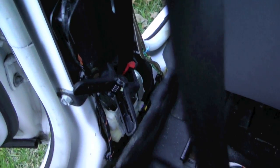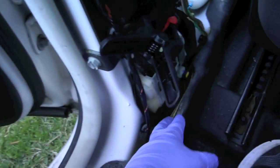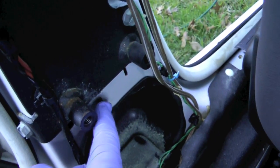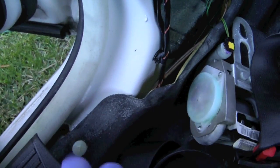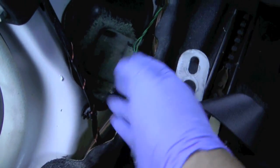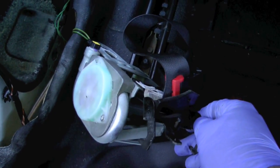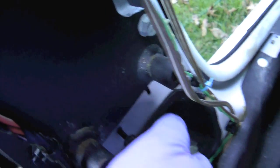The belt is now fully extended and clipped off. I'll unbolt the Torx bolt at the top, the bolt at the bottom, and once those are out I think this whole piece will come out. It's out — there's one more screw there that holds a guide I didn't mention earlier. Once you unbolt it from the bottom, it's easier if you pull the rubber floor clip up so you have access, because this piece comes up and tilts out. At the top it's retained by these little J-shaped hooks that have to come out of their slots, so pull those up.